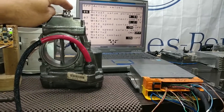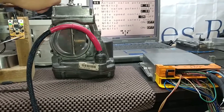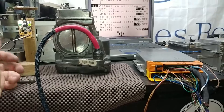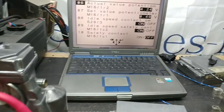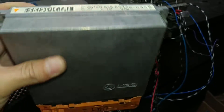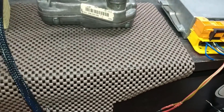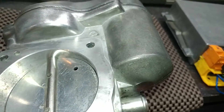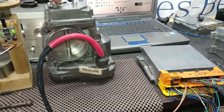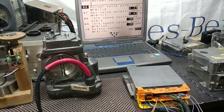You can see the micro switches change and the potentiometer changes, which proves the throttle test is successful. The E-gas module works, the throttle works, all features are good to go, and the clutch coil has been energized for days with no issues. This combination is ready to be mailed back to Lithuania to Paulus. The E-gas module appears to be a first-month 1995 model, and the throttle body was produced in the 12th month of 1994 — so most likely it's a 1995 S-class S420 or S500. This is Victor at RestoreYourMercedes.com, thank you for watching.